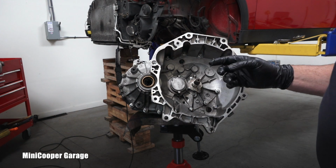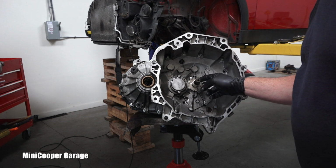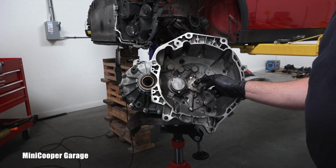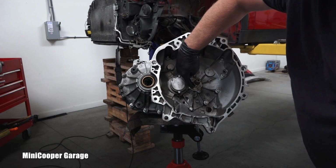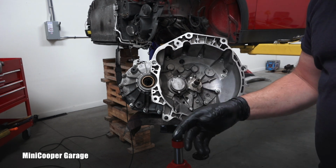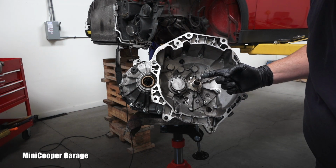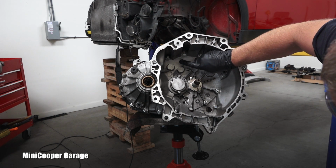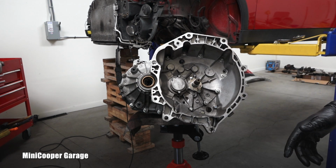And obviously the purpose of that grease is to make the bearing release easier, so that there's no tension, right, on these parts, and it nicely keeps sliding. You keep it only there because you don't want to get it anywhere around the clutch later on, that will be a huge problem. I will also put a very, very tiny amount on this pivoting spot right here where the lever keeps resting.